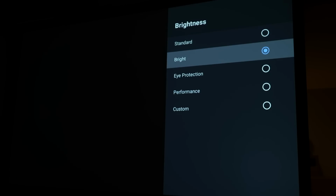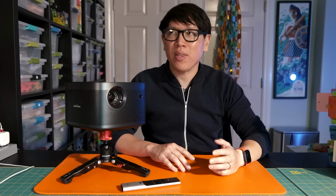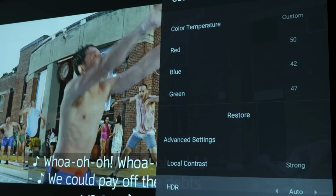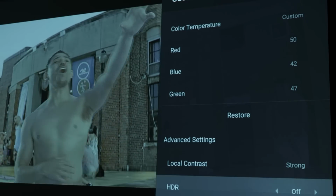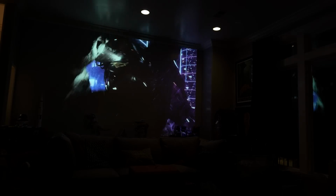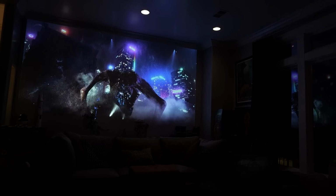It's rare to reach what you can do with OLED on that technology. But on the high end as well, I found that even the brightest spots, even with HDR content, weren't giving me that telltale HDR glint in live action: the kick light in the actor's eye, or the rim light on the back of someone's hair. You can actually see that HDR is turned on and it's processing that metadata. But even at the rated 2200 lumens, the difference between the brightest parts of the image and the midtones and the dark spots isn't wide enough that I felt like I was getting a full HDR experience in luminosity, even if it was giving me very good color representation.